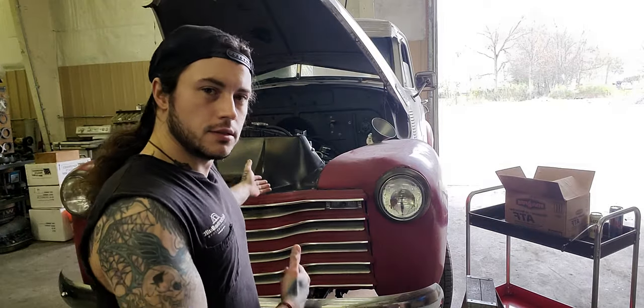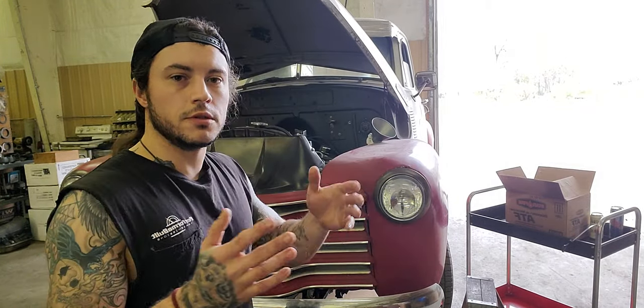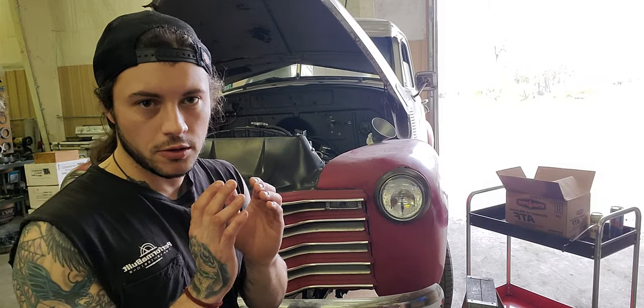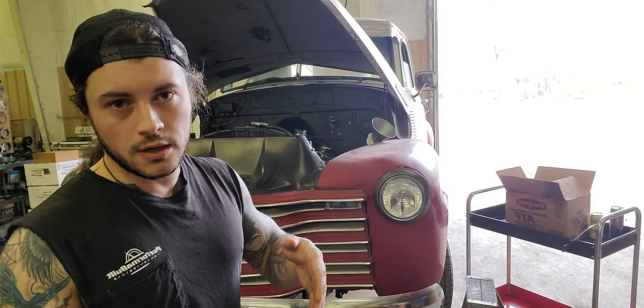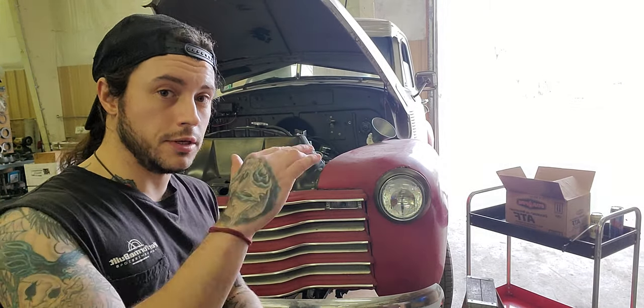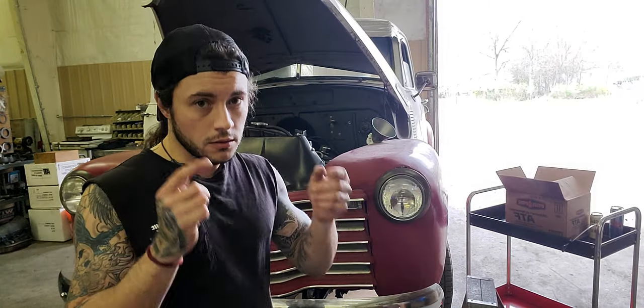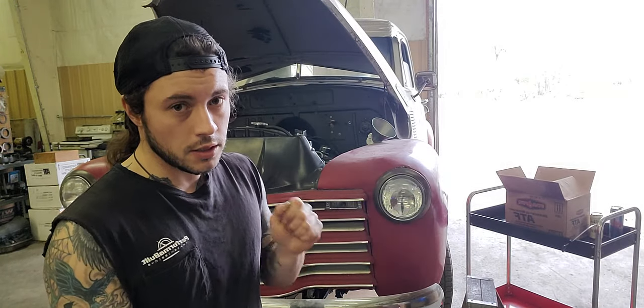So in this instance, the 2000 Camaro had that, okay? The moment you start modifying things, putting in a smaller converter, a bigger cooler, more or less line, whichever way you're going to go, and a deeper pan, you can go real deep if you want. Things have changed, quarts have changed. No set number anymore. It's up to you to use your brains a little bit and check your stick.